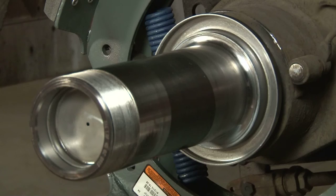Properly installed wear rings can protect spindles from scratching and scoring, and that can help extend the life of your spindles and other wheel end components. I hope these tricks will help you on your next repair job.